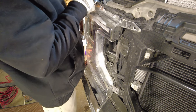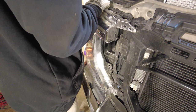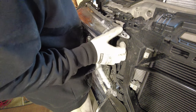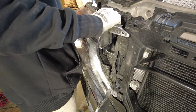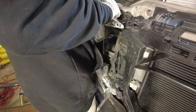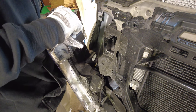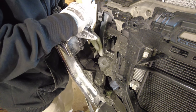This clip on the fender side — you've got to work it out so the clip doesn't get in the way. Set the first headlight down in a safe place where it won't get scratched. Here we are on the other side — you've got to have the right finesse. Lift up the tab, watch out for the screw, work it out. It's all about the finesse. Watch that screw, work it out — swing it this way and out.